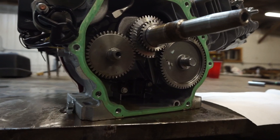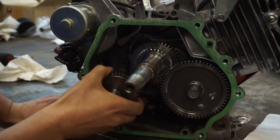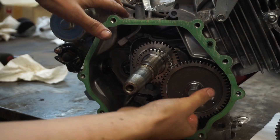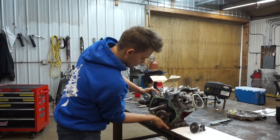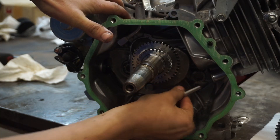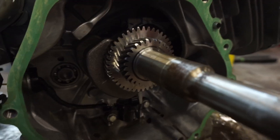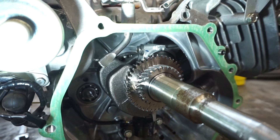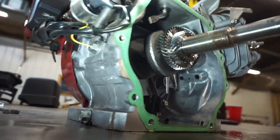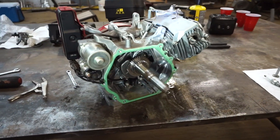At first glance this might look a little complicated but really all it is is a bunch of gears - they just pull right out. Next we're going to take off the connecting rod cap. There's a bolt on the top right there and one on the bottom you can't see. We're going to take that off so we can just slide the crankshaft out and it'll all be good.